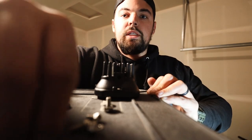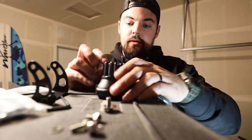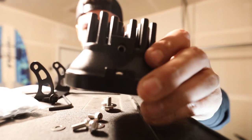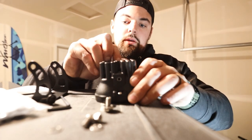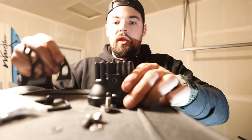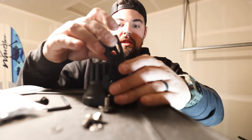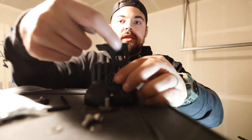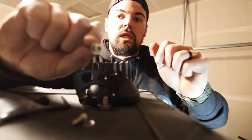And then from there, this one is ready. You're going to take your little nylon nuts, drop those into the light — you'll see them on the side. So you drop it right inside that little channel there, you can see the little silver part of the nut. Drop in the other side — you want the nylon going in towards the light. Then I'm taking the diode bracket; the plug is on the bottom of the light, and I'm having this go angled downwards like this, so the plug is down here on the light, this is going downward.